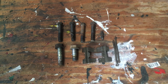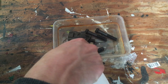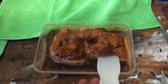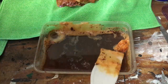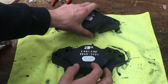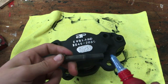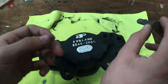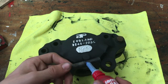Here is all the hardware from the calipers. We remove the split pins since we won't be reusing them, then put all the parts into a container, fill it with vinegar and let it remove the rust. A few days later there was some kind of gunk floating on top of the vinegar — I removed that and used a scraper to pick it all off. After that I could clean the hardware. Now that all the parts are painted and cleaned we can begin putting the entire caliper back together. I used medium-strength thread locker on all the bolts to make sure they never come out due to vibrations, because the last thing you want is your brake assembly to fall apart while driving. Once they were all finger-tight I went around with the ratchet and tightened them all up.